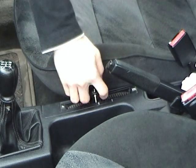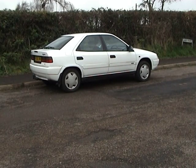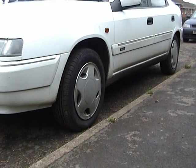Now we'll put the car into service high, which is usually used for changing tyres. This is where I must stress you must never go under a hydraulic Citroen without it being supported properly with axle stands, as the outcome could be quite messy.